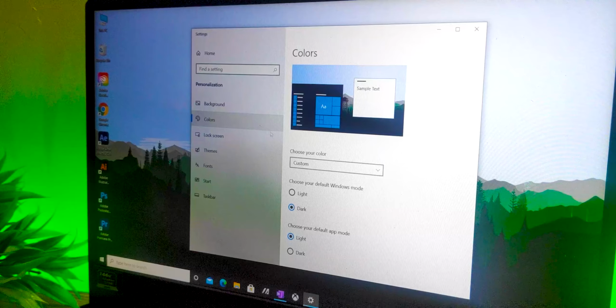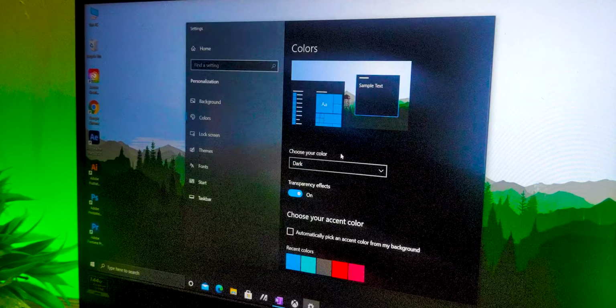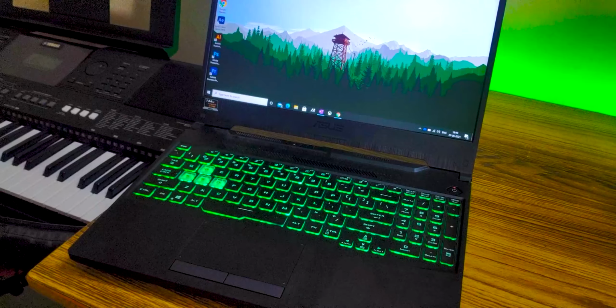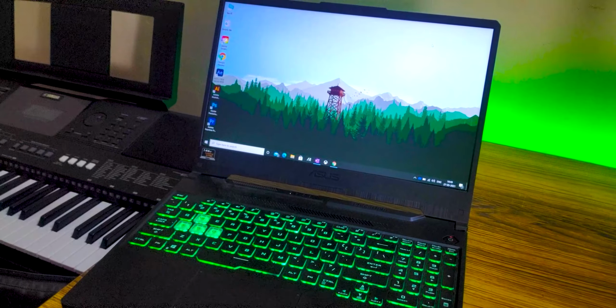Now remember, this was one of the tips to save battery, but this thing only works with AMOLED or OLED displays, like I said before. And for LCD panels, this doesn't work, and the reason is that unlike OLED or AMOLED panels, LCD panels are backlit, meaning that a light source behind is always being lit up based on the display's brightness that you had set.